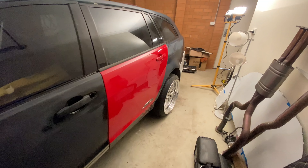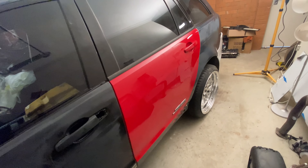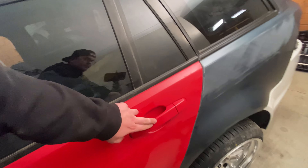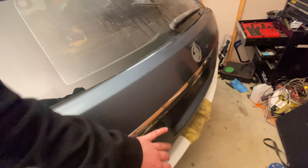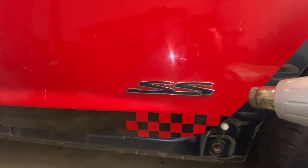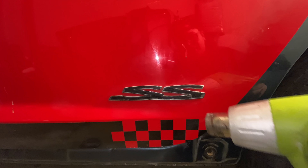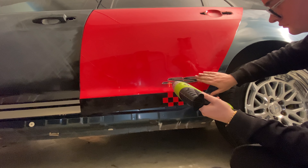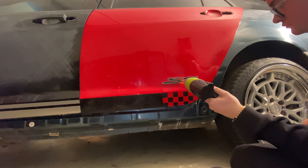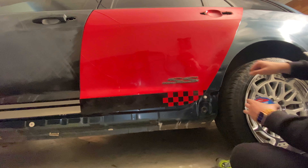Got the door on. Now I have to remove this badge and the vinyl down here as well. I'll pop the door handle off too, which is really easy. Reese will bring a caramel wheel so we can knock those out. These badges are simple to get off — not the glue per se, but the badge itself. You just heat up with your trusty heat gun, a bit of fishing line, and it comes straight off. As easy as that.